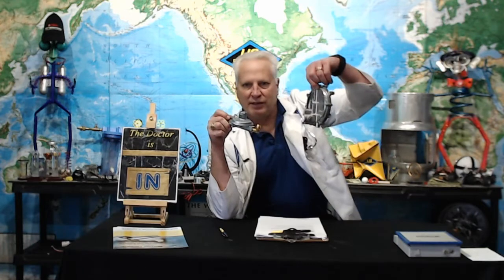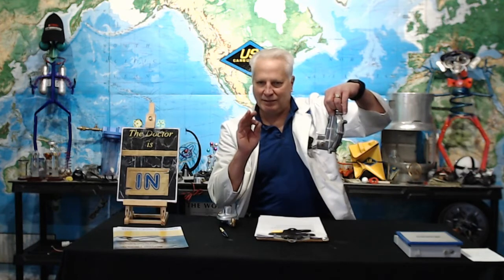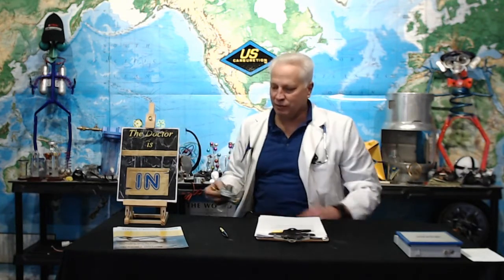Did that make sense? As we change the temperature of the propane, we can show you how the pressure changes. And so a regulator keeps it at the same output. Like in our NPSK accessories, these are 11-inch output. That allows the engine regulator to have a consistent input so that the adjustments stay consistent. If the tank pressure is 80 pounds and goes to 90, that can affect the performance. So absolutely, you must have a correct regulator on your system to run propane.